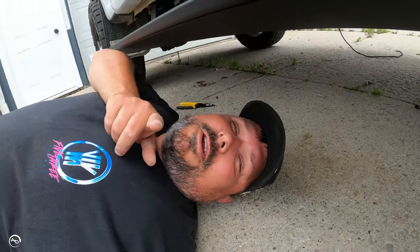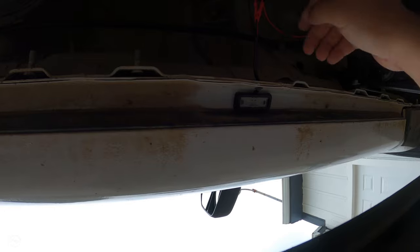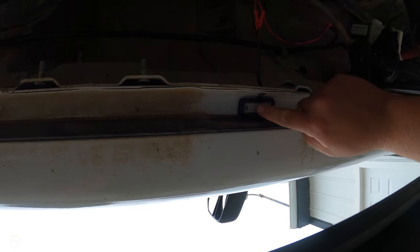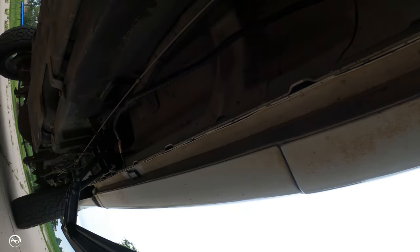I really wish I could edit this out so I don't look like a bigger idiot, but how else is anybody going to learn? Those of you who are really smart already caught it — the rocker panel is the bottom of the door. I went to open the door and rip — the wires were hanging out from the LED light. So I rewired it: the light mounts on the other side of the pinch weld seam. It's a pain because you've got to bend the wire so much to get it to sit flush — the higher your hole, the better. I redid that one and the rear one as well, then did the other side.